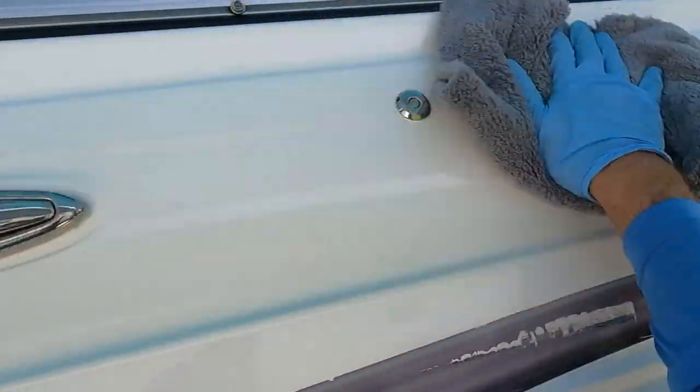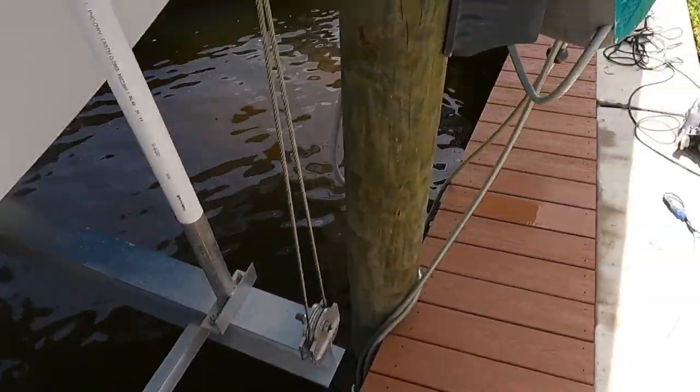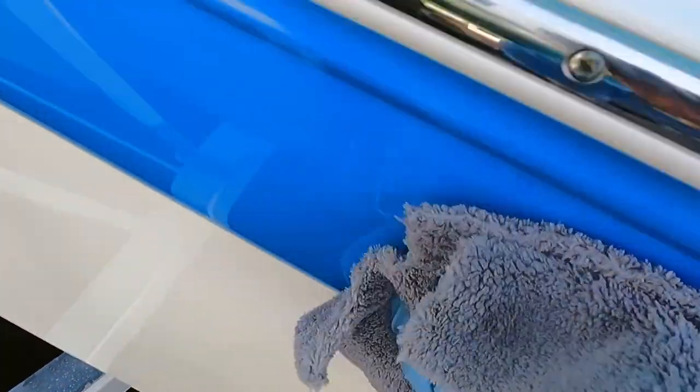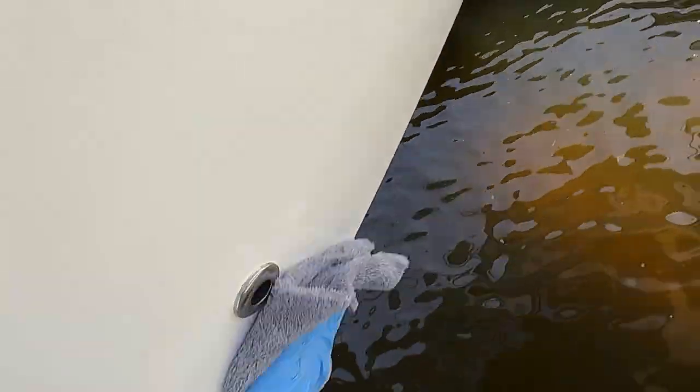We're going to come back with two towels. The first is an Adams Polishes microfiber plush towel — it's a great towel, available on Amazon, and it's incredible. It has so many fibers and picks up all that excess so easily, making your job much easier. We want to make sure we're not using a rough microfiber towel — no ordinary kitchen microfiber, that's not going to cut it. We have to have a plush microfiber that's safe for paint and safe for gel coat. We'll wipe off all the excess with the first towel, then get a second towel and wipe off everything again to make sure all the polymer is off the boat, ensuring quality control.